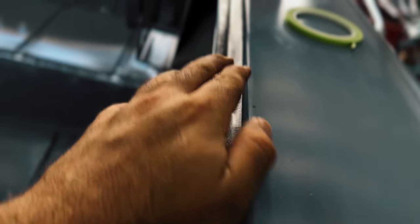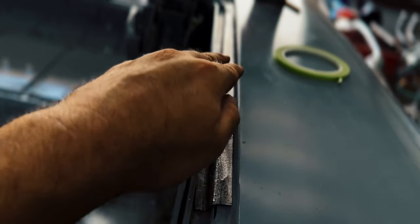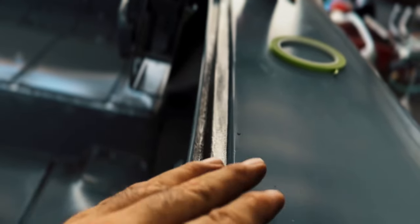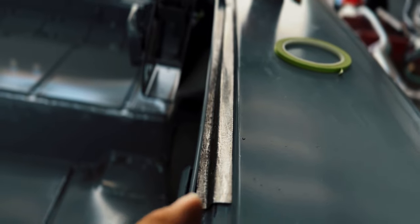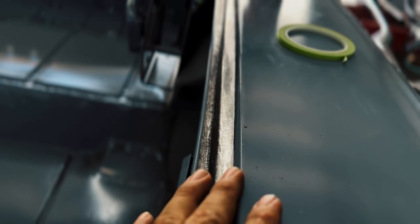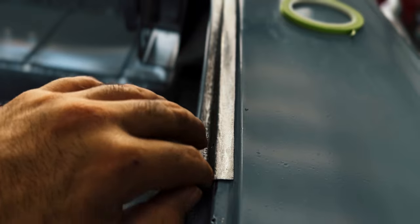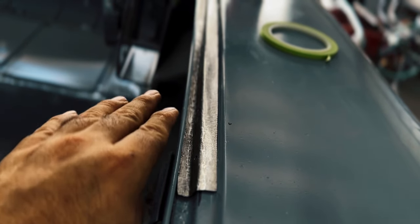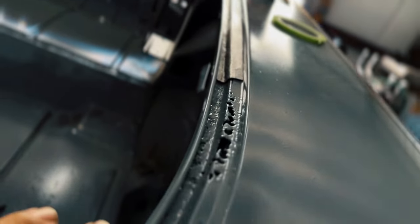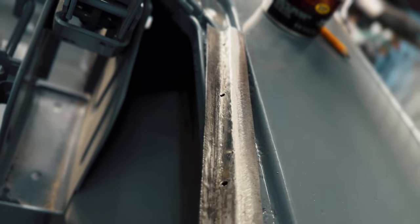So I was having to shrink in here until it kind of bowed like this, and then I was having to planish and stretch this top part out so it lay flat, because it kept wanting to bow up. When you start bowing this part, this top part is going to bow too, so you have to go in there and planish on a straight edge like I was doing, and then keep shrinking that area so it'll bow this bottom section, because this does have a slight curve to it. It's not just straight. This trunk starts to go down progressively, and then it swoops around. But there she is. She lays down flat.